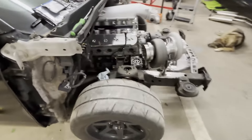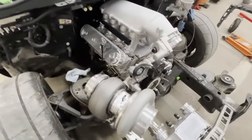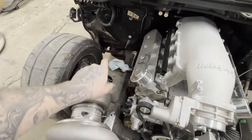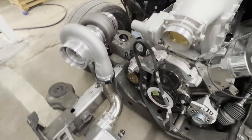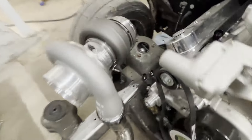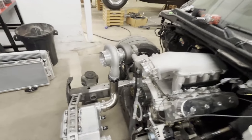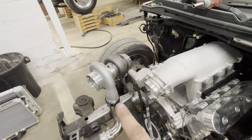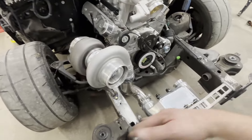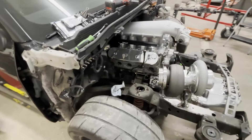It's going to be even cooler when there's a whole pile of hot side stuff going on. I'm really excited to have some super shiny tube work in here. I haven't mounted this yet strictly because I really want to see how this whole area is going to come together. There are going to be two 2.5-inch tubes here that come into the bottom of the turbo, and bringing that all through here is going to be really tight with a rad hose, AC hoses, heater core hoses. I'm a little nervous, so I haven't fully committed to mounting that to the head yet. Worst case scenario it's in a really good spot — I can push it forward an inch if I have to, and there's a ton of room on this side of it.